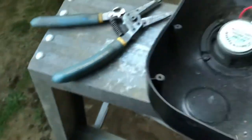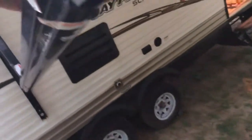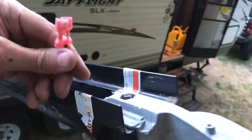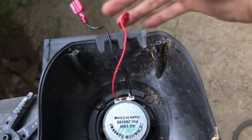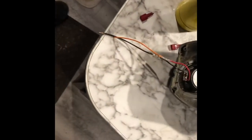What we're gonna do is cut these plugs right off and pull the wire on the inside out. I got the connectors out — I'm going to cut these off. You could get a weathertight splice connector if you want, but I'm just gonna hard-wire it right in. There's no reason I really need to take these off again, and if I do I'll just cut it. You could also solder this, but we're gonna use a butt connector and I'll show you how to do that.